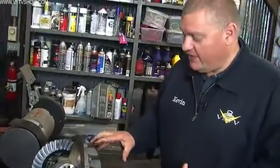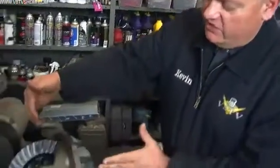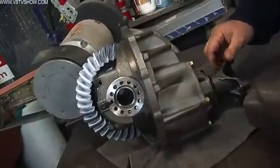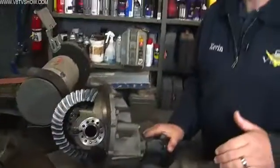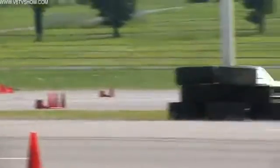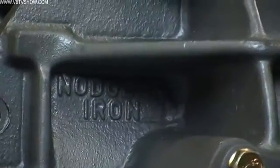When they set this up, the procedure is to measure the depth of the pinion gear in relation to the ring gear in thousandths of an inch — super, super precise. Now imagine the effect of 500, 750, or 1,000 foot-pounds spinning this thing with a big sticky tire under a heavy car, and what that's going to do to your thousandths-of-an-inch level of precision if the case is allowed to flex at all.